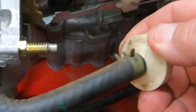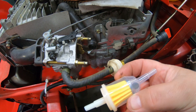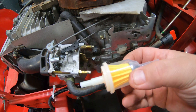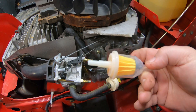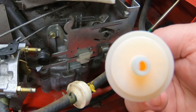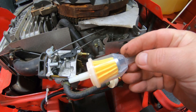We're also going to replace this little fuel filter. The red and white fuel filters on these engines really don't do a whole lot. I'm going to replace it with a paper filter. When I install these, I like to put them facing down so if you get any water in there, you can actually see it, and it also helps you see sediment building up. The arrow on the filter tells you how to install it — always have the fuel coming in on the side where you can see the sediment accumulate inside the filter.